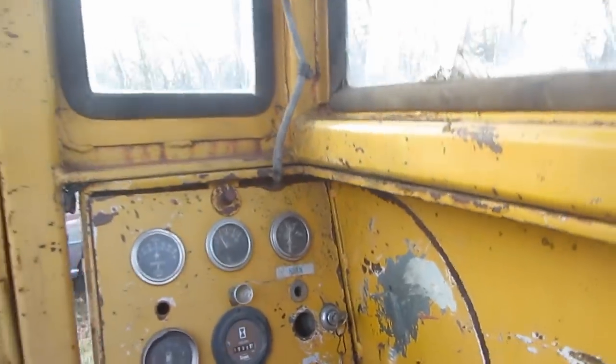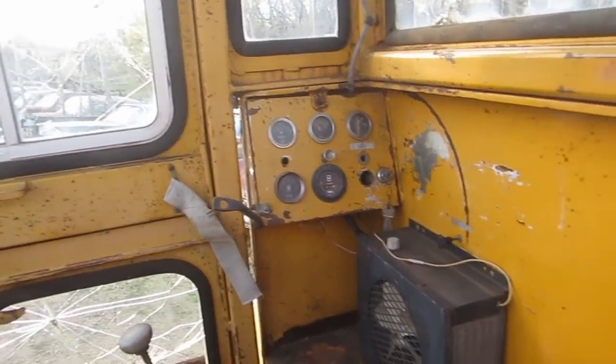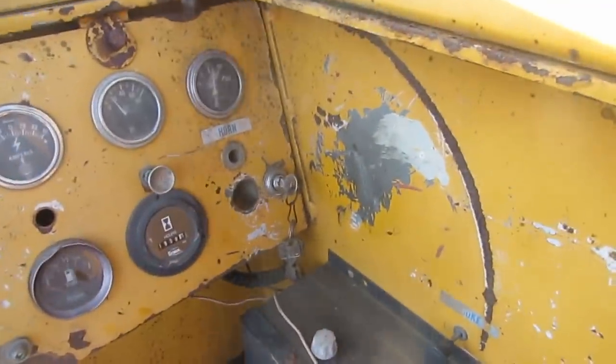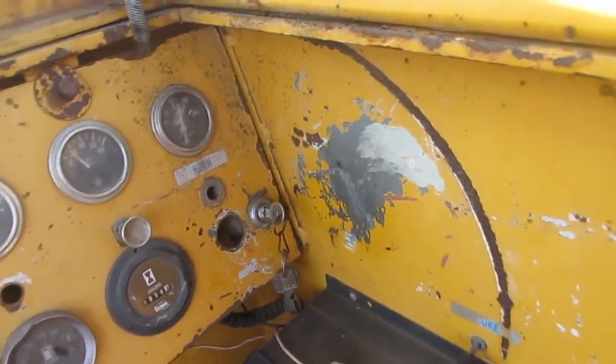Well, I'm going to throw a charger on it before I write the whole job off, but I shorted it with a screwdriver and it cranks right up. So the starter's fixed. The wiring is just really bad. Okay, forgot to hook up another wire there. So the ignition wasn't actually live. That makes a difference.